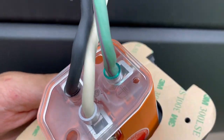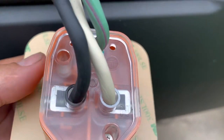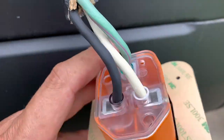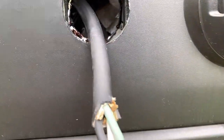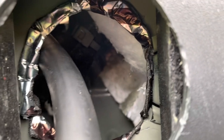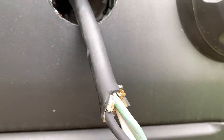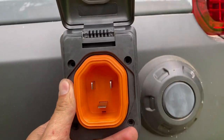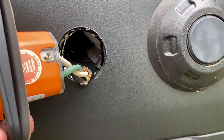I am now ready to mount the smart plug. The wires are color-coded — on the insert: green, white, and black. They also have a strain relief that goes on the back, but since I need to go straight through I'm not going to incorporate the strain relief. I lined the sheet metal in the van with butyl tape material so that any sharp edges are covered for the cable coming through. Once it's all mounted and installed, I'm going to shoot Great Stuff on the backside to make sure that it's waterproof.